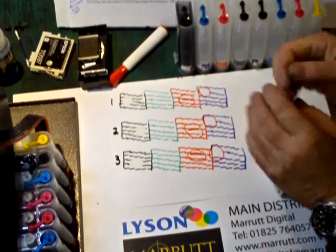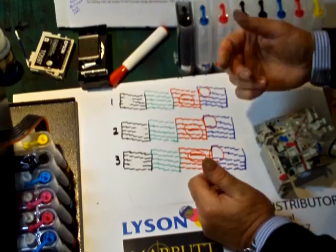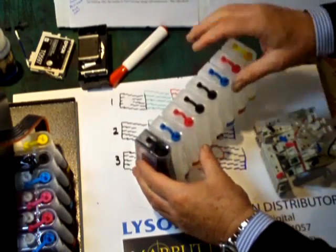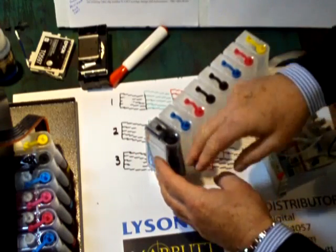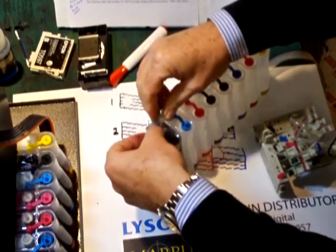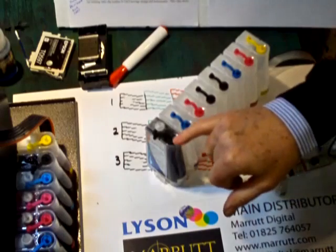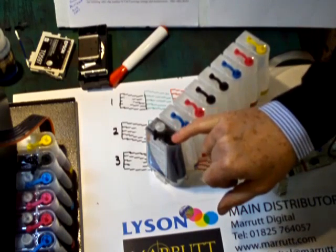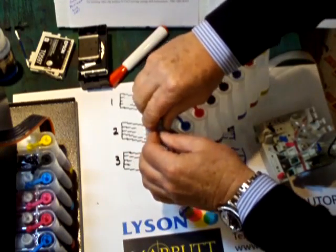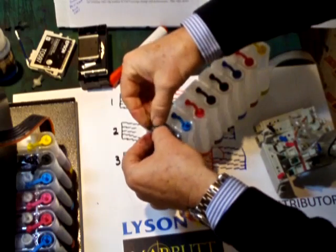If you need to service the underside of your ink reservoir - for instance if you've got air appearing underneath or a slight leakage - you would need to be able to turn the whole reservoir upside down. Here we have a demonstration reservoir which we've partially filled. Usually all these would be full of ink with the little reservoir on the back and a breather. If we turn this upside down with the breather in place, ink will come out everywhere. So what we do with this style of reservoir is take the breathers out and put the bung back in.